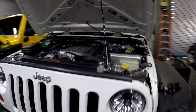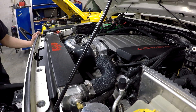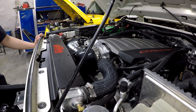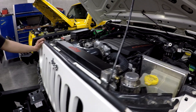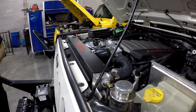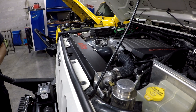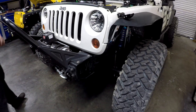Stepping over here, we're really stepping up in technology. This engine has continuous variable valve timing — the cam is constantly phasing. So instead of the transmission downshifting, the cam can phase and give you a burst of power without changing gears. The transmission is a 10-speed, giving us a wider gear diversity than the 6-speed. The 6-speed has a 4-to-1 low and 0.67 overdrive, far better than early Chrysler transmissions like the 42RFE with only about 2.8 low and 0.8 overdrive. The 10L80 is about 4.6 low and 0.6 overdrive with 10 forward gears, combined with an engine that has as much torque at 2,000 RPM as most engines have at 4,000 RPM.